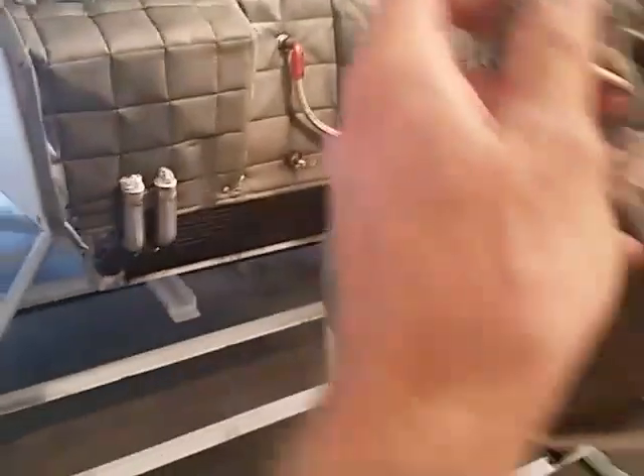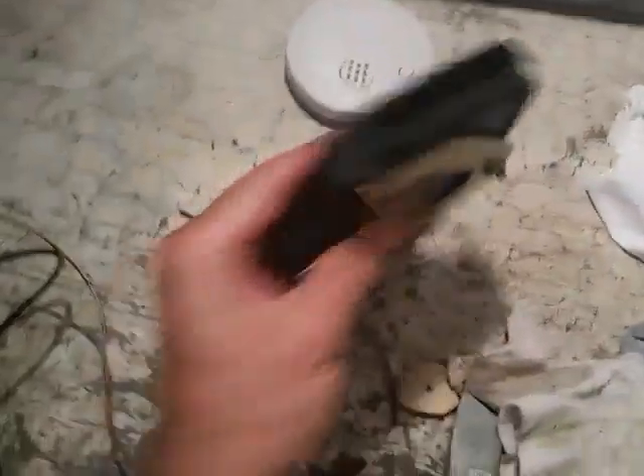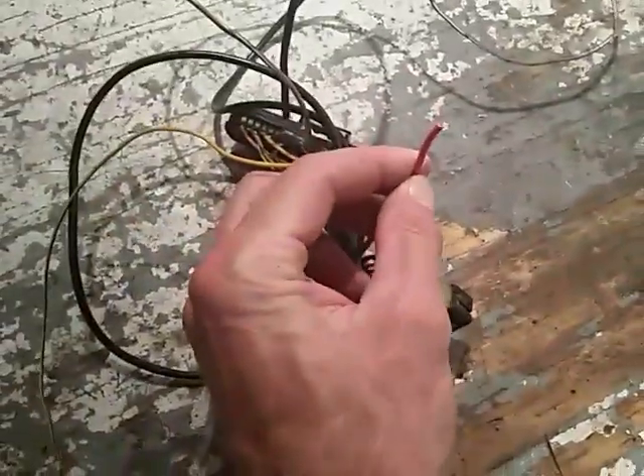Wiring is real simple. That's all that comes out of the motor right there. And here's the rest of the wiring — here's your ECU. That just gets plugged in, straight and simple. Off that we got ignition, tach, and starter relays.